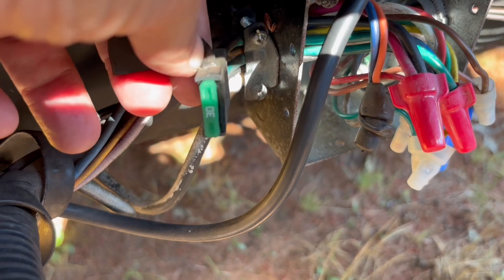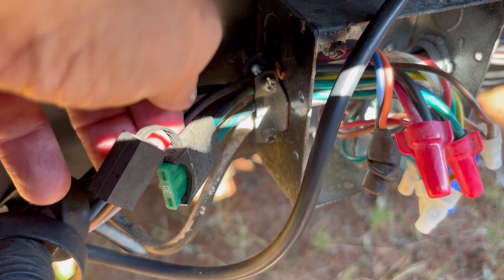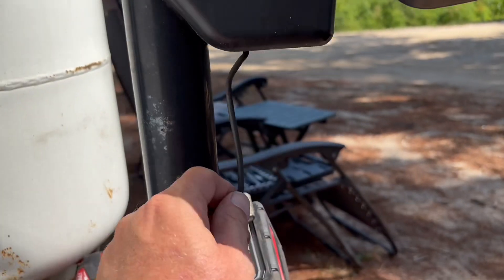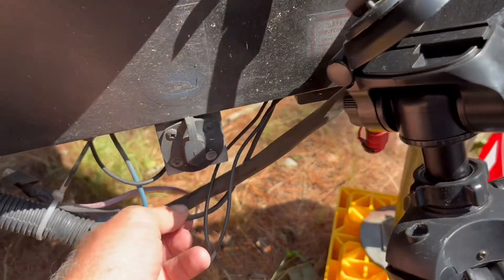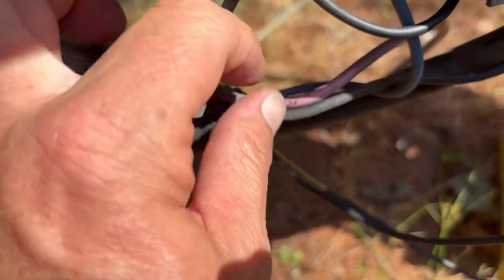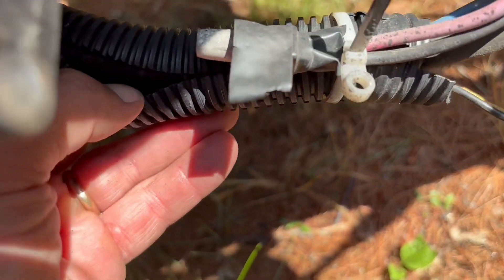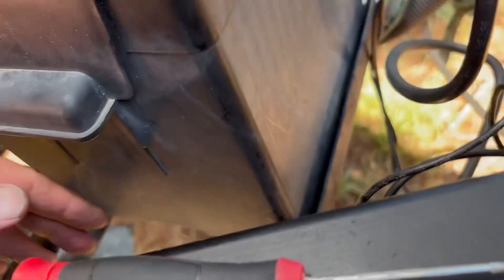The purpose of the rest of this video is to show you the circuit — how I conclude that this fuse is attached to the jack. I want to trace the circuit that flows from this power line through this fuse. We know this is our black power line that comes up into the jack. I can see the motion of this black wire, and that black wire comes down and connects to what looks like a pink and white wire, but it's actually a red wire that's just faded from the sun. All these wires are going through this wiring harness conduit, so they become hidden.